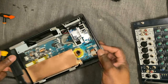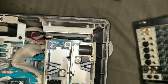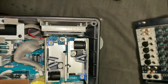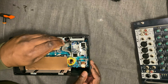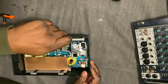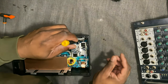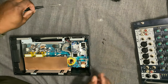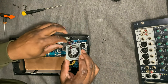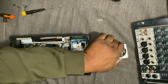There are two fans inside. That's the main fan there — the bigger fan. There's two screws, one here and one over here to release it. So here you can see me just undoing the screws to release the main fan, which I'm going to have a look at today. I'll just remove the screws with the magnetic screwdriver. That's the fan there. I'll just unplug it from its connection onto the PCB.